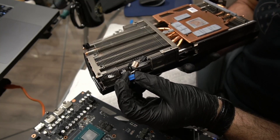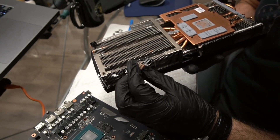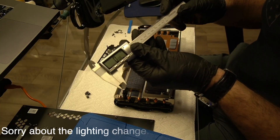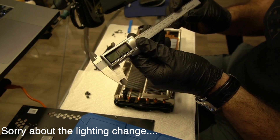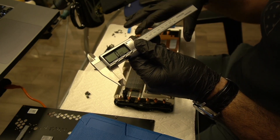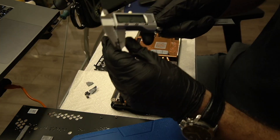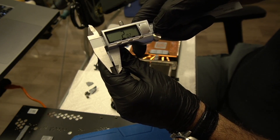Don't pull on these wires — make sure you pull on the bracket itself. Make sure you guys don't break the connections. So we're going to measure the pads now. If you don't have one of these tools, definitely get one. I'm going to put a link in the description below to Amazon — it's where I got it. This thing is really, really good in case you don't know the pad size, like we don't know on this GPU. So I'm going to have to go ahead and measure each individual one to make sure we get it right. It looks like these pads are just about two millimeters.